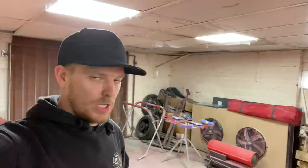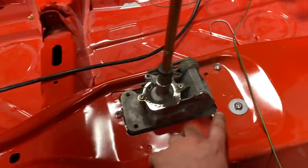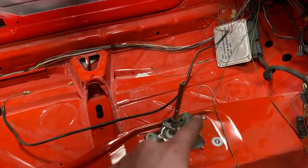So obviously got the rear brake conversion on, you've already seen that lot. I've now got the gear shift mounted in. We've got one there, and one there as fixings. I've modified the linkage. Here at the back and here at the front, there's a little bit of aluminium on the actual selector housing. I've just cut them off flush with the piece underneath and made three little spacers. I think they're about 20 mil, I can't exactly remember. Drill and tap, drill and tap, drill and tap through the floor and into the tunnel, into the housing, and bolted that down. Coming in here, we've then got all the mechanism on.